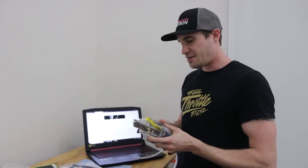So in combination, these changes, what do they mean? They claimed from dyno testing a KTM 250, a 20% increase in torque and horsepower below 5,000 RPMs. So just a lot more pickup on the low end, especially for a two-stroke, you guys know. And again, the higher airflow through this carburetor is going to increase the fuel pickup, and it's also going to increase the overall performance, meaning a faster, quicker hit for you guys right off the bottom through the mid-range and carrying into the top end.